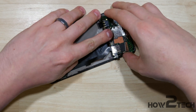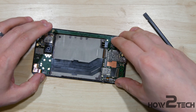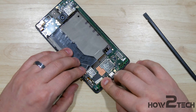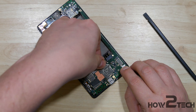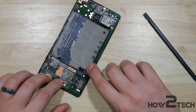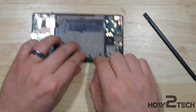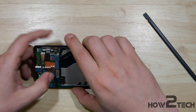We can go ahead and put the logic board back in. Now it won't just fall back into place — you want to make sure the ribbon cables are out from underneath the board. You'll kind of need to snap everything back in. On these longer cables, make sure you press on both sides. Make sure all of the connectors are pushed in. You can push down on the side here to get it to snap back into its slot. Make sure the camera is seated properly, then you can push in the connector up here at the top.